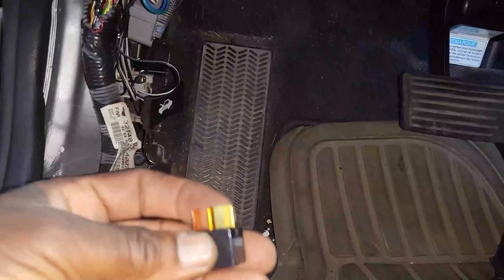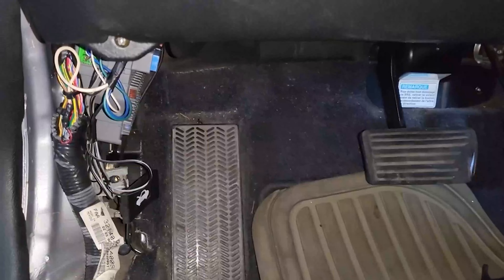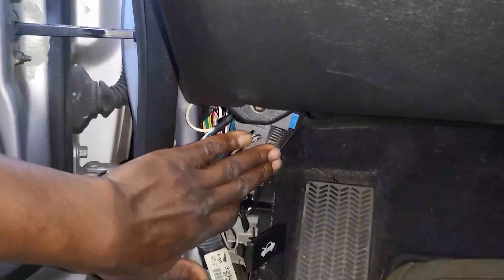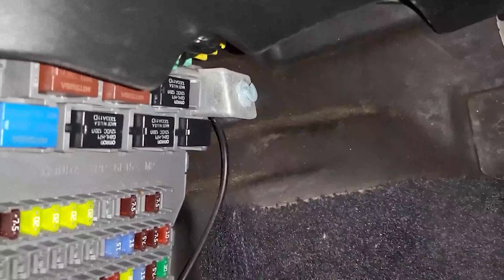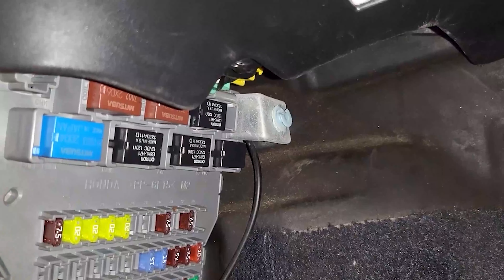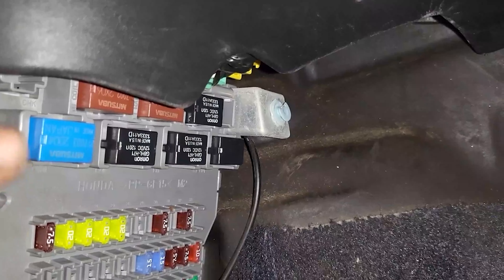We opened this cover and the car will not crank at all — good news, it doesn't want to crank right now. We went to the auto parts store and got that relay. We took the cover off and here is the fuse box — they call it ICU or MCU. If you change this fuse box, most of the time the car will not start, will not crank, so you have to program it.